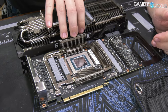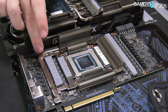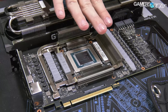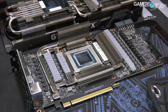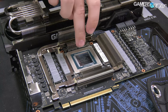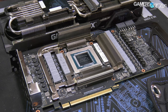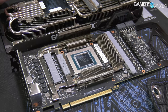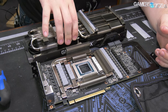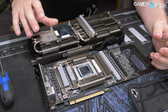The board is fairly simple. The cooler is also fairly standard, but this separate plate did really well for Sapphire with its Nitro design on the 5700 XT Nitro — they had a similar separate plate. It's just additional fins mounted directly to the memory and part of the VRM. There's a heat pipe running through this stack, keeping the GPU thermal solution separate from the memory and VRM rather than sharing one copper cold plate, which could slightly raise GPU thermals.